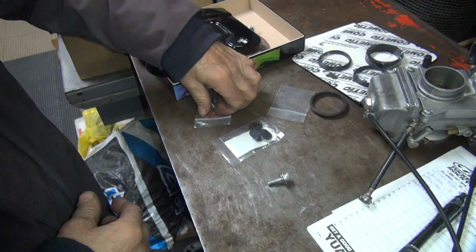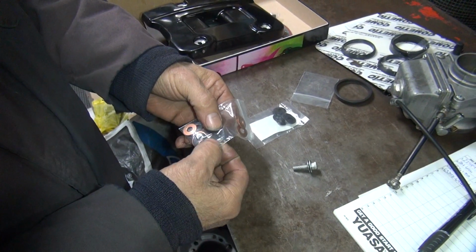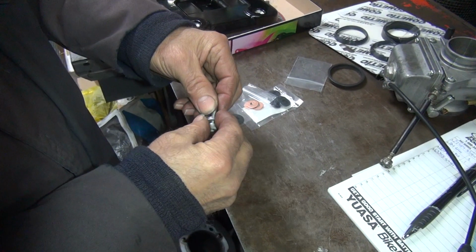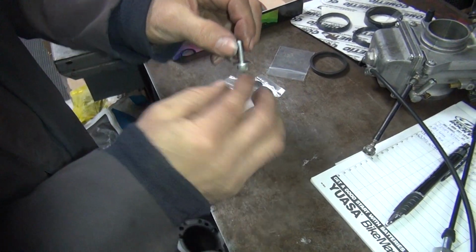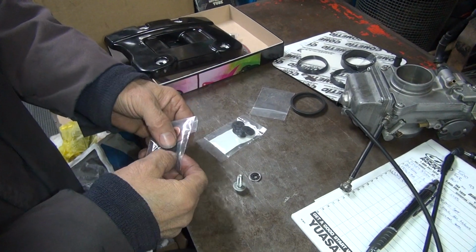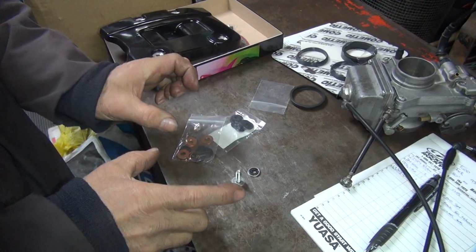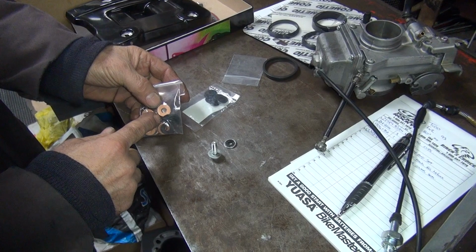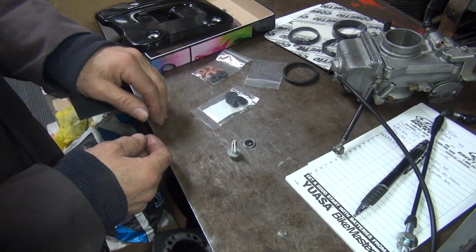Harley, what they did was they have a copper washer and then a paper washer, and you don't put anything on it, and you tighten it down, and that's supposed to seal it. And these washers right here, what happens, they bow like that, and when you tighten these down real tight, because you are supposed to tighten them down really tight, it splits the washer right in half and then it leaks right out of it. Copper will not seal on its own, so why do you even use those things? I never use them, never have used them.